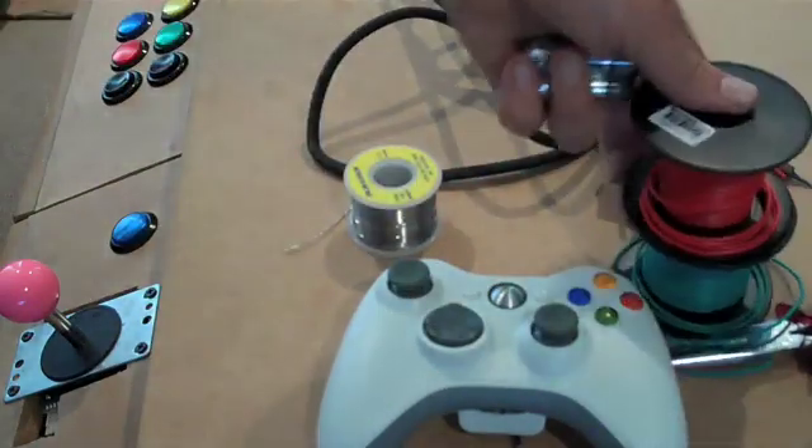There are six visible screws — one, two, three, four, five, six — and there is a seventh one. Don't forget this one: you need to pull off the barcode sticker and behind it is another screw. You must be using a T8 style torx screwdriver.